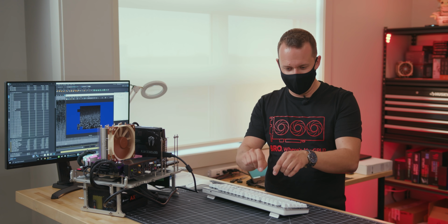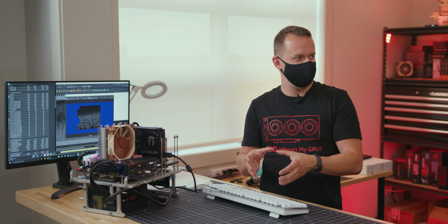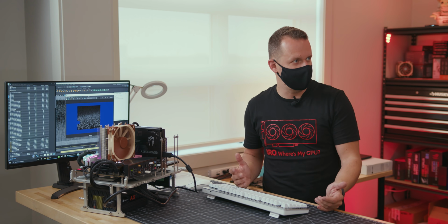Do I have to worry about going a little bit further than my actual IHS on my CPU? Will it short out components? Yes, it would short out components if two components would be shorted. On an IHS, as you know, you wouldn't be able to short anything. Just cut it so that it's slightly smaller than the IHS and you'll be perfectly fine.